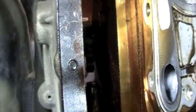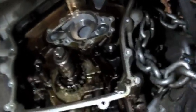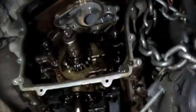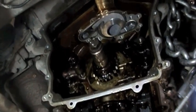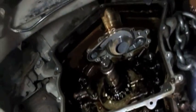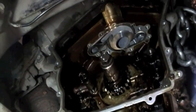It's basically a hydraulic piston driven by hydraulic pressure. When your water pump goes bad, it leaks coolant into the oil and clogs up your filter, because the engine begins to form sludge and oil begins to be starved from the oil pump. That lowers the oil pressure and you get your oil light. If you continue driving, it'll gradually lower the pressure as sludge builds up, eventually damaging your oil pump and seizing your motor, or it'll just gradually slow down and your hydraulic primary timing chain tensioner will slowly let go of slack.